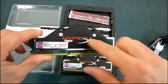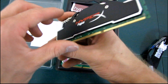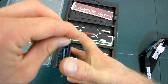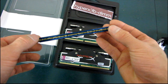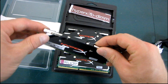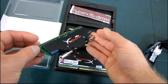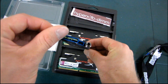You can see there's screws here and here, and those go all the way through. Presumably that's clamping the entire heat spreader down on top of what seems to be like a sub heat spreader. I can't tell if the black one and the blue one are actually permanently attached or just clamped together. And then there's a thermal interface material between the heat spreaders and the DIMM itself. They're not that heavy, actually — really not that heavy. It looks like these barbs just go straight through, so there's no winding around through the water block. RAM doesn't produce a lot of heat, so even just giving it some contact with cool water should cool it more than adequately.